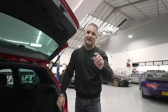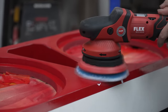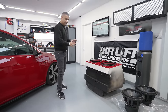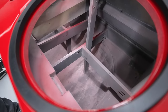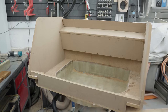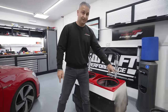Now the box. If you recall earlier I showed you the box in our paint room — it was covered in primer, drying out — but since then a lot has happened. The top section of the box has now been painted in red, and now at least you can see the box in its full glory. If you look inside the box, you can see the bottom section is all made out of fiberglass resin and fiberglass matting. The reason the bottom section is like that is to maximize the space available — to give us probably another half cubic foot of space. This box is going to go in the back of the Golf, and the subs are here as well.